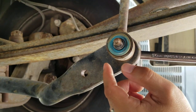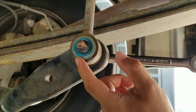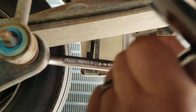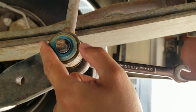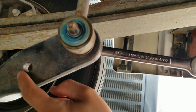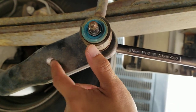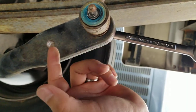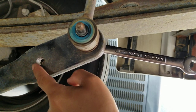To do the fix, I went ahead and removed the bolt. This requires an 18mm socket — I used a 15mm wrench to brace the side and a breaker bar to break it loose. When you move the bolt to the new setting, this stiffens the suspension so it won't sway as much. You'll want to do this to the rear as well — this particular step is for the front. The torque spec is 66 foot-pounds.